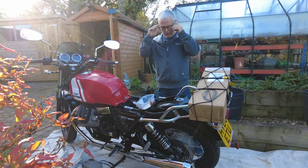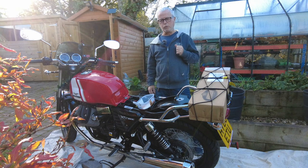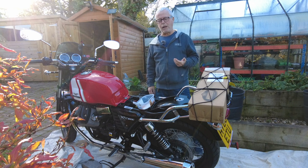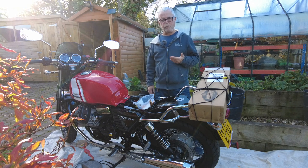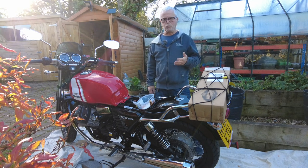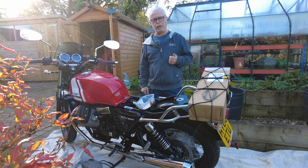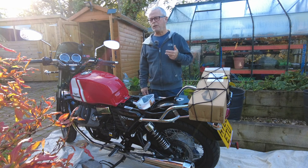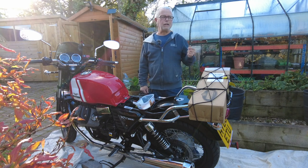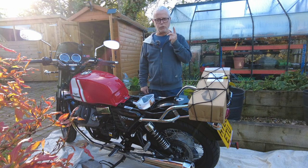Before I do that I decided to check the air filter box, because from reading the forums and Facebook page there's often trouble with oil flooding back into the air filter box when it's been overfilled. When I checked the oil level on this bike, sure enough it's full to the top. There's also quite a bit of water in it which is pushing the oil level up — that's the reason for getting the oil changed, to get good clean oil in. I was hoping to leave the oil in over winter because it's only done 150 miles since it was last serviced, however whoever did it filled it way too full, so I'll show you the photos of what it looked like.